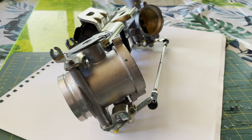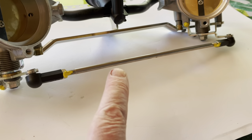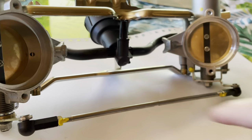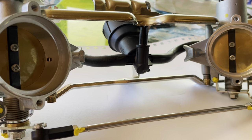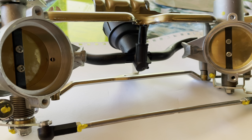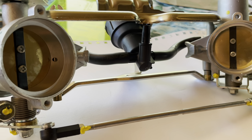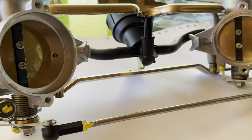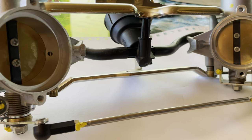When you're moving the bell crank screw, it moves the bell crank, which will move the linkage rod and brings the throttle plates on each of the throttle bodies back into equilibrium at that high point. When the throttle is then closed, you use a small amount of air bypassed through one or other of the air bleed screws to equalise the pressure at idle. And that really is it. Anything that needs to be done after that is going to be mechanical — it's not going to be a tuning issue.